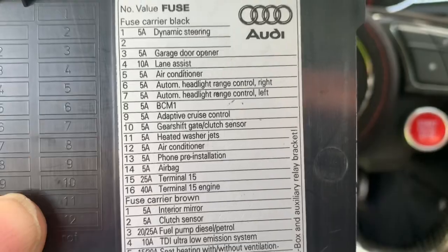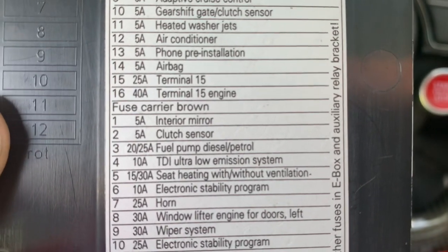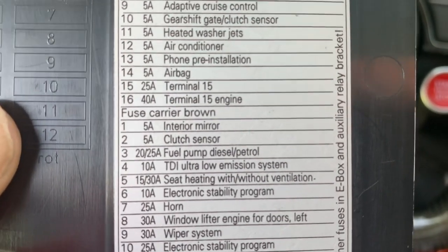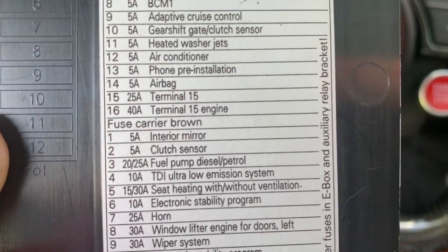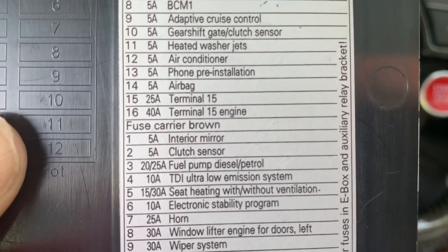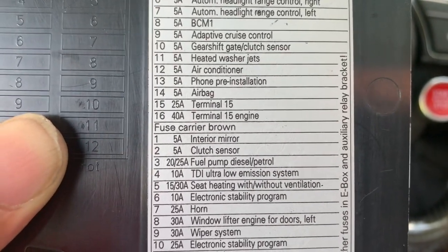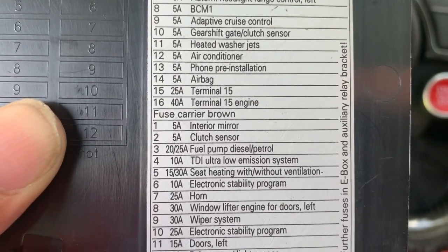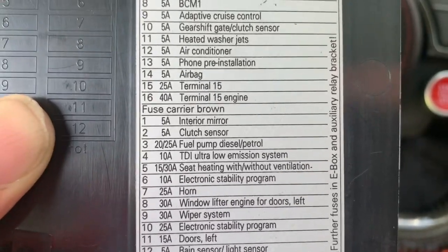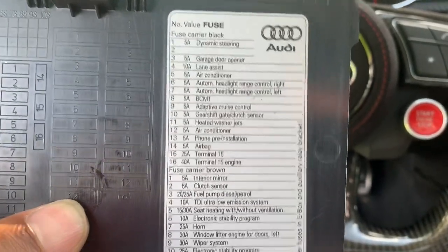Now a secondary fuse that you can use if you want to is your fuel pump. You take the fuse out of your fuel pump, it won't supply the injectors with fuel. So your car will crank, but it won't start. You're going to get the ch-ch-ch-ch-ch, but it won't turn over. That's just a secondary one, but I feel like the first one is more efficient. It's more seamless. You don't have to worry about running without fuel in your vehicle or going through that tedious process. Those are the two ways that you can put a kill switch on your car